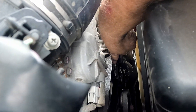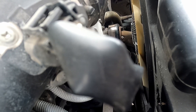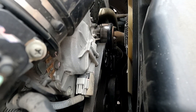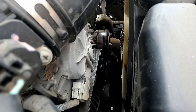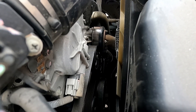It's this idler pulley right there, the top one. Unfortunately I sprayed it with a little WD-40 trying to prove and see if it was in fact the idler pulley, and it quieted down right away. So I don't have a record of the sound anymore, but I'm going to go ahead and take the pulley off.